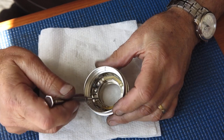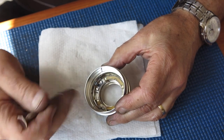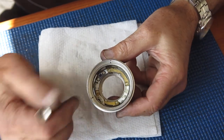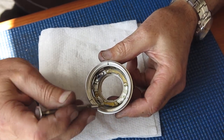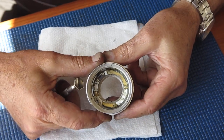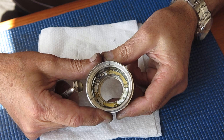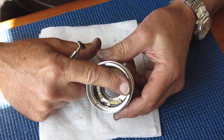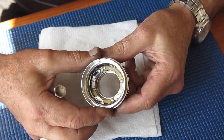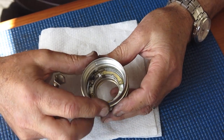You can see two brass brackets here, held by a total of four screws. They hold this focus ring to the body, and they're not correctly adjusted — you can see that because there's a lot of slop there. That's where that rattle is coming from. Because the lens capsule's mount is mounted on this component, it means that the lens capsule was actually moving slightly too. So you could end up with focus problems.